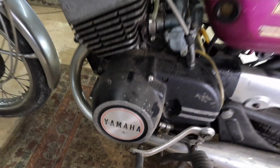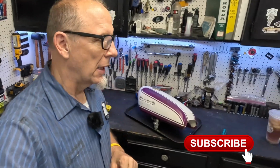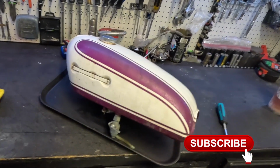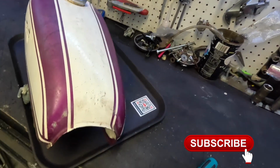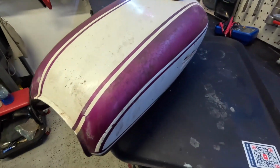We just need to bring an Allen wrench so that we can pull the side cover off so that we can clean the points, and then get spark on the right side, and hopefully, fingers crossed, it'll run. But one of the things while we're doing that is we're going to go ahead and clean this tank up because I can't stand to look at it anymore. And I believe it can be better. So let's take a closer look at this guy.